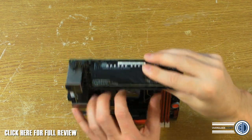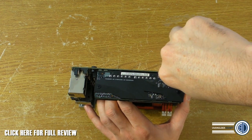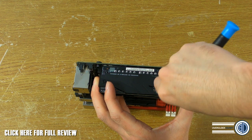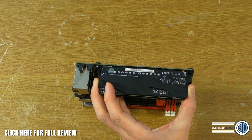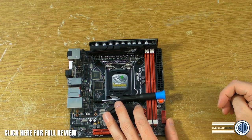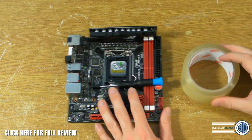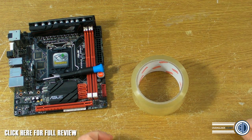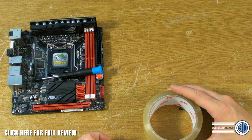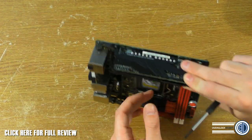We need to take the heatsink off — I'll try the small screwdriver. A tip: rather than leaving screws loose on your desk, put a strip of sellotape sticky-side up and drop the screws onto it. You can still see them, move the tape out of the way, and when you bring it back the screws are still there. Simple but useful. So the screws go there and that's where they're staying.